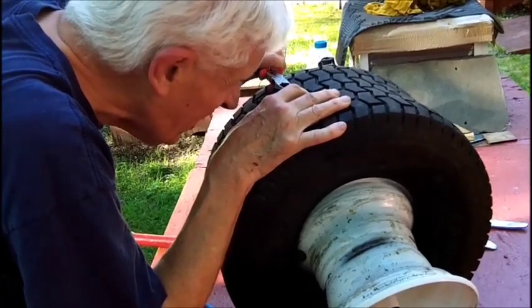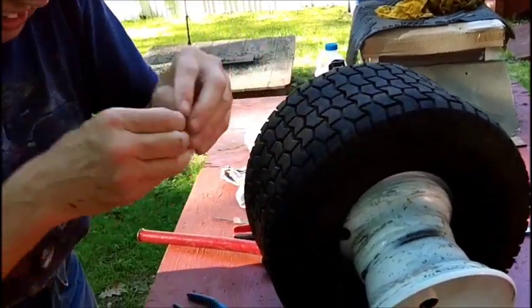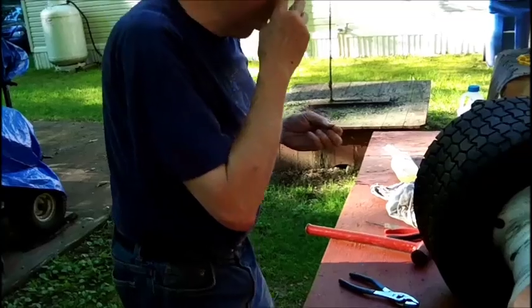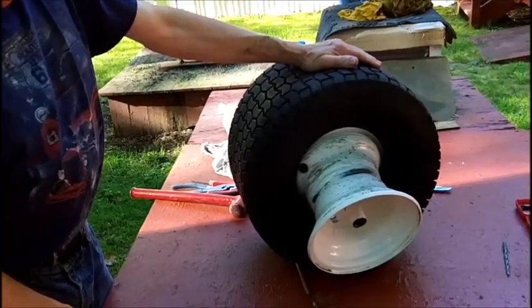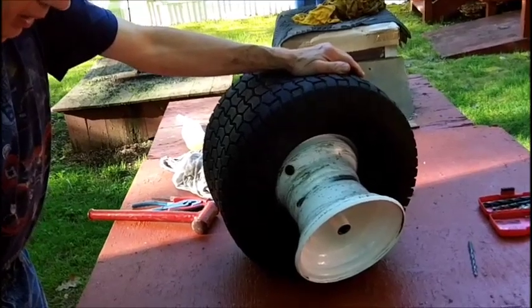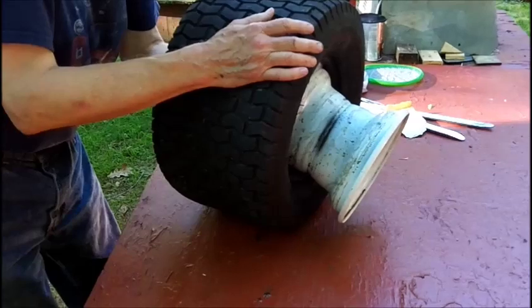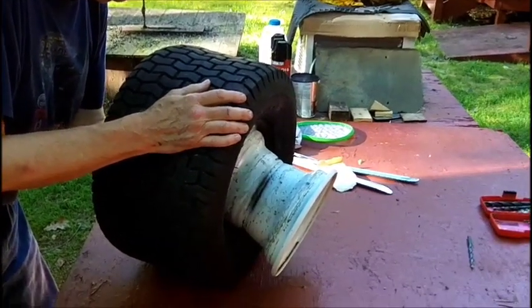I think I got it - there it is. Don't get stabbed by it. There it is - nail! It's about a half inch long. Now that was sticking out about that much, which means my mechanic would have put the tube in and I would have had a leak. And I won't pay to have them done again - I'll just put slime in it. And I don't want to do that.